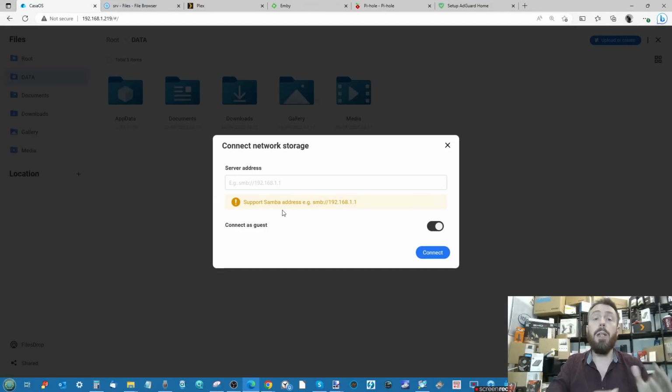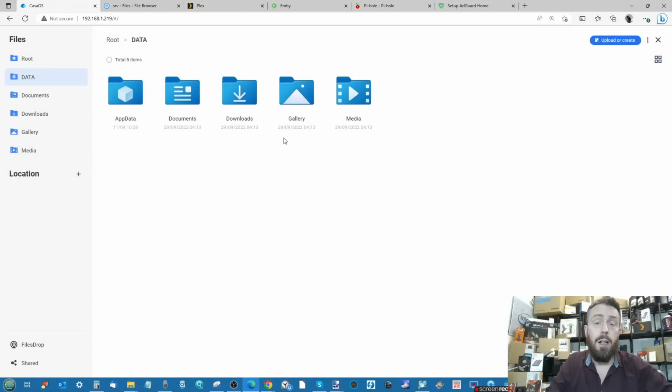You can do that, but you will of course need to have the credentials for that, and it's going to be network based, which on this device on 1 gigabit Ethernet, you're looking at 100 to 109 megs for remote access to another NAS there. But at least you can use this as a $200 additional storage layer, or at least storage management layer.